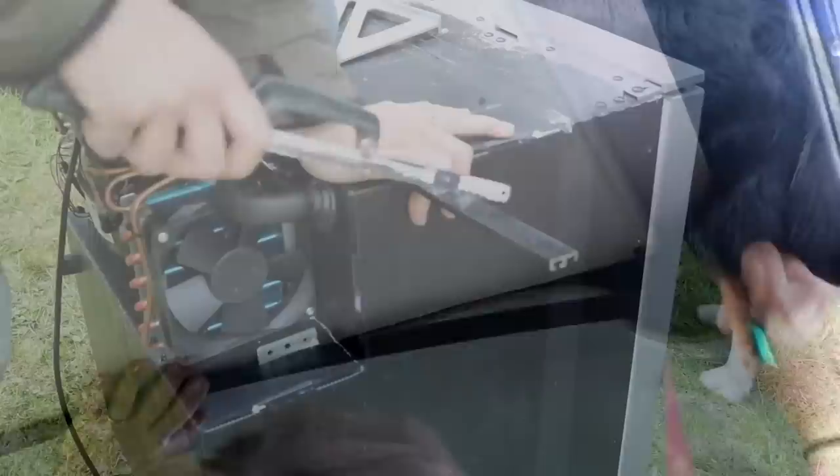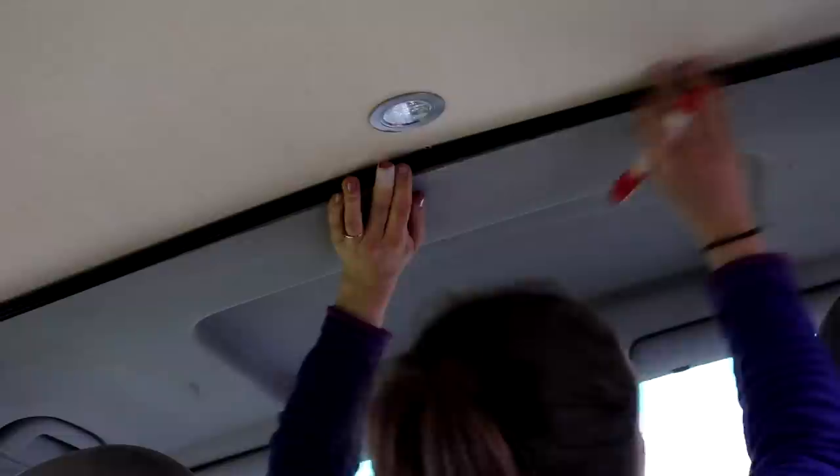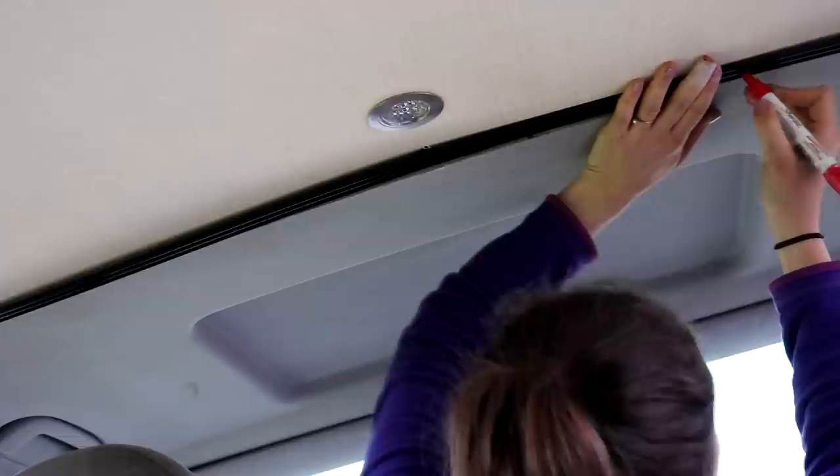Now it's cab dividing time. In the van there are grooves at the top left and right, and these raw edges were exposed the moment we removed the bulkhead. I held the cab divider track along the top and just marked roughly where I wanted to cut it — let me know what this tool is called below because I can't remember what my father-in-law said but it was really handy. Once I'd got it to the right length I marked with a contrasting red pen where I wanted to screw it, knowing there's a bit of wood above the roof so we weren't going to have any accidents. I created pilot holes with a 2.5mm drill bit and screwed it into place.